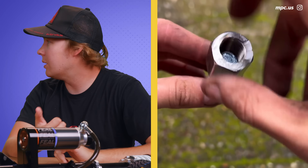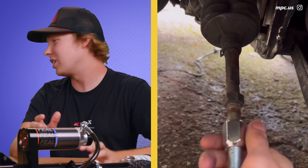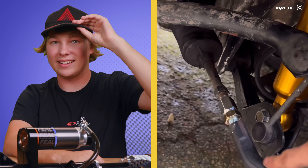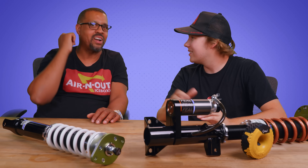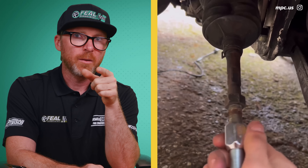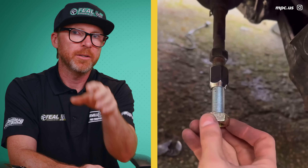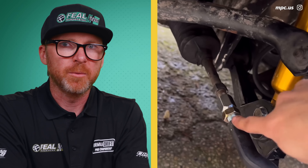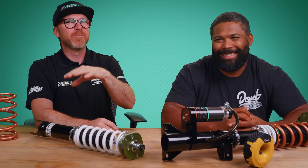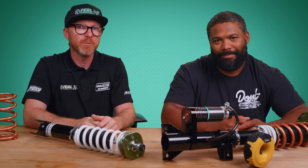Drifting started out as a grassroots sport — you do it cheap and do stuff like this so you can get out on the weekend and swing the car. This is stress relief — working hard all week and then clearing your mind. Eventually you want to get proper extended tie rods, and sponsors. My main concern is the grade of the hardware. Rule of thumb is you need enough thread engagement — so if it's a Lexus SC300 or SC400, it's going to be an M14 inner tie rod, requiring 14 millimeters of engagement into that lug nut. I don't think that's engaging 14 millimeters on both sides, but the thought process is there. He needs a longer lug nut or a threaded rod. It's cool that he used off-the-shelf stuff from an auto parts store and got it done.